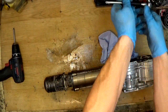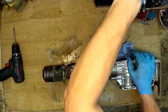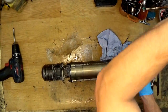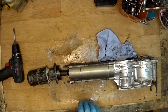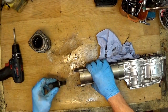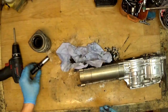Now we'll open the hammer casing and check what's inside. I need to push it a little bit. It's going — and the hammer here, you can see it has some slide wear, there's a bump here. You can see the metal color is different, so we need a new hammer — definitely.